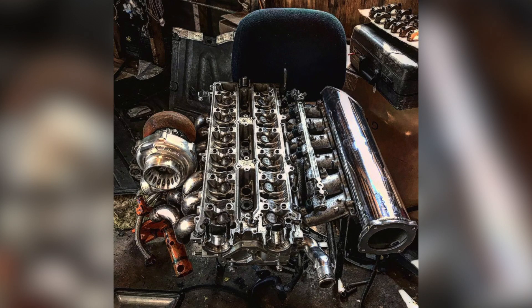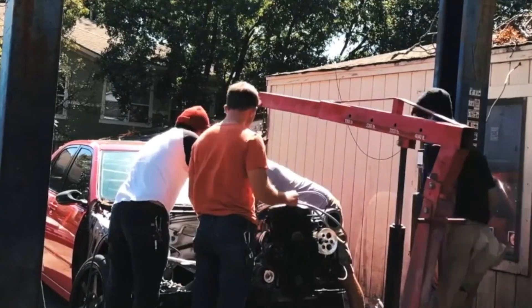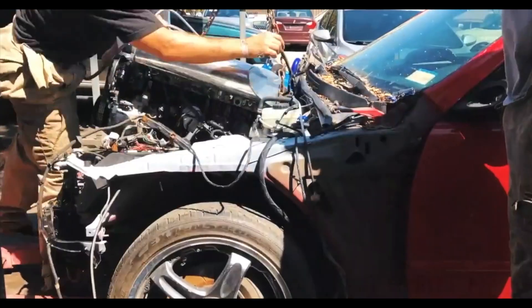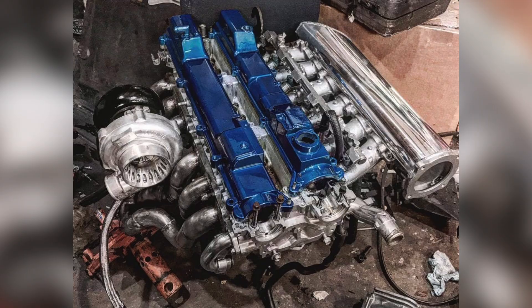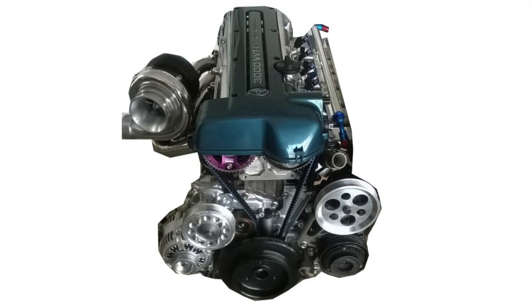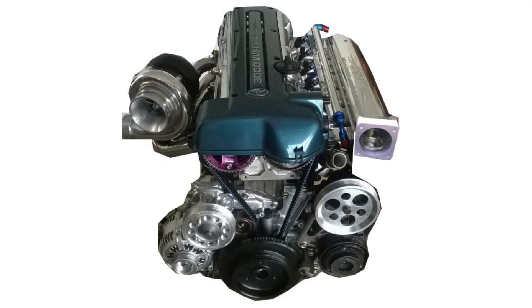There are two ways to install the intake manifold. The way I went with is having the engine completely out of the car, installing the intake manifold, and then putting it back in. Or you can remove the head, install the intake manifold, do the intake runners with the head off, and then drop the head right back on the block. With the engine out, I drilled holes in the intake manifold for the brake booster, the boost gauge, and a sensor. Next I put the intake manifold on, installed the throttle body, put the engine in the vehicle, then the power steering adapter, the power steering reservoir, and then the throttle cable.